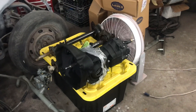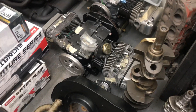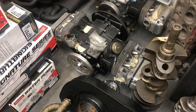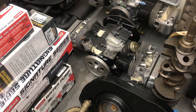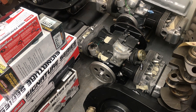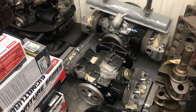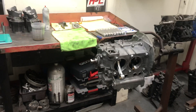We'll be getting that going probably next week, hanging out here working on Volkswagens. I'm a little behind - hopefully I get caught up. Sold the 1600 down here, need to put some sheet metal on that and got some rocker arms dug up for it. We also have a 1600 with dual carbs going into a sand rail - he's got a nice motor in the rail with some Super Flow heads. We're going to take that motor out, put this one in, and freshen up what I think is a 1915 - 69 by 94 with Super Flow heads - for sale. He's going with something more streetable for the beach and cruising. It's all about fitting the motor to your driving conditions.